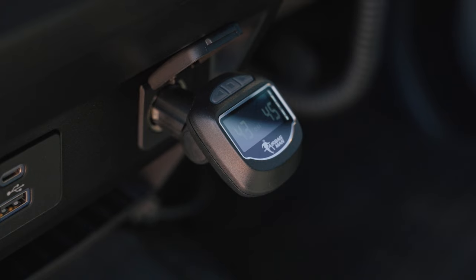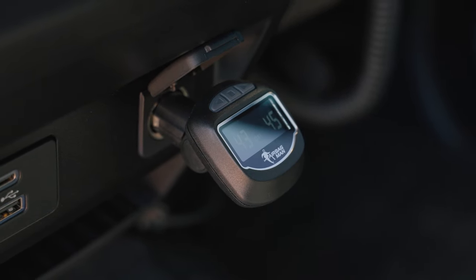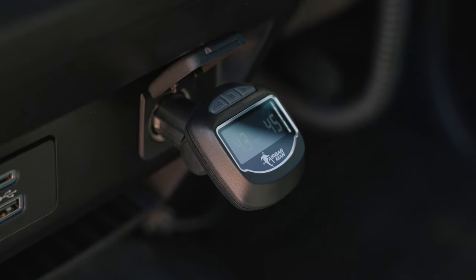When the vehicle is loaded up really heavy and towing, we can easily now up the air in the airbags. The leaf helper kit will bring the tail end of the vehicle up nice and level. The twin Viair compressors under the vehicle, as well as the 11 litre stainless air tank, are switched through the Airbag Man pressure control module. For this, we've gone for the full wireless pressure control module, as well as a wireless plug and play digital gauge, so you can see what pressures are in each of your left and right airbags.